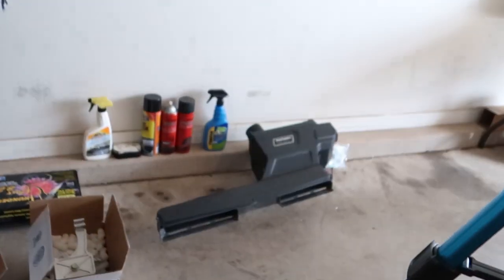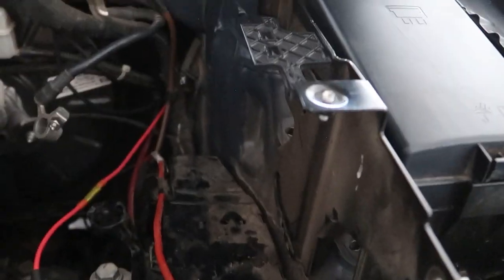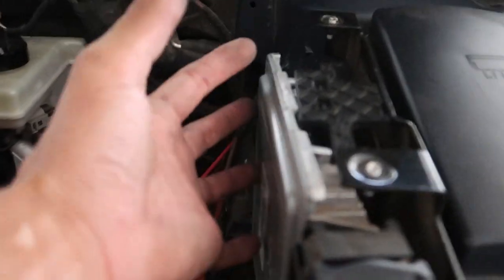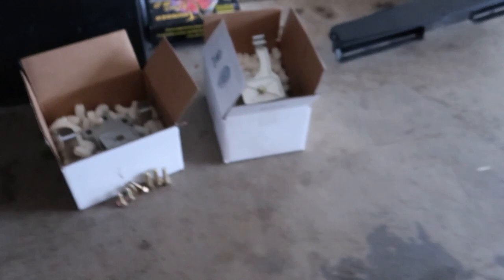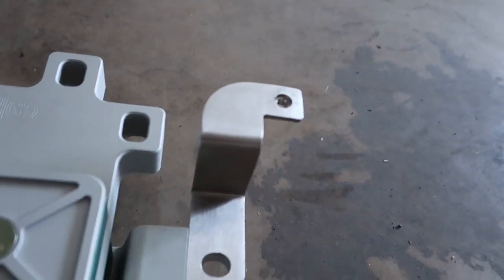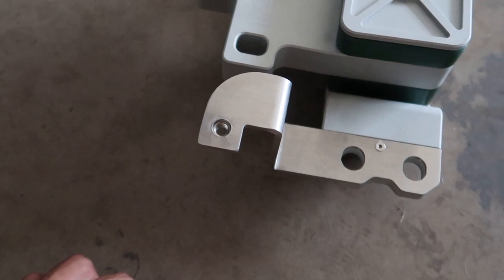Intakes out, battery out, battery mounts out — there's three tens on this one, two, three back here in the corner. A lot of people don't have this metal ECU cage; mine is metal so I just unpopped it and moved it over. Then there's this panel underneath — I gave it a yank off. You got two bolts back there, two bolts on the other side, and three up here, and the trans mount comes out. The design of this new one is way different than the old one.